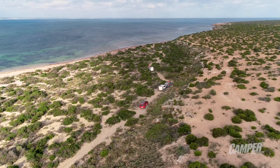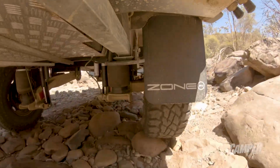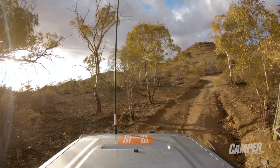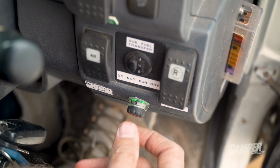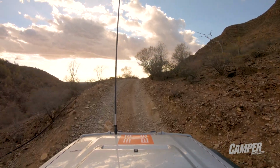But more importantly, I also found that it was really effective off-road. We did some pretty technical trails early on in the trip, and that included some very loose and steep climbs. And when you're doing that, you can actually move into a user control mode, which means that it is going to take away all of the proportioning, and it is going to give direct braking when you put on the brake at that level that you've selected on the dial indicator.